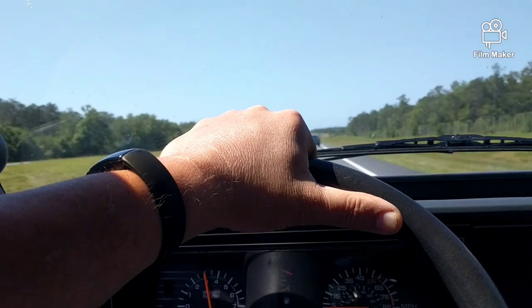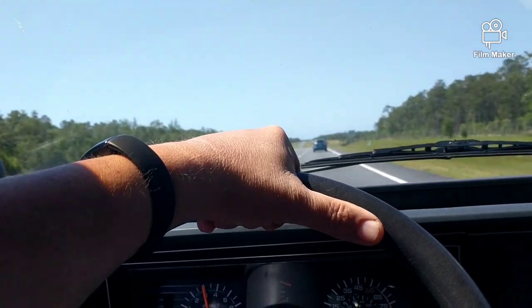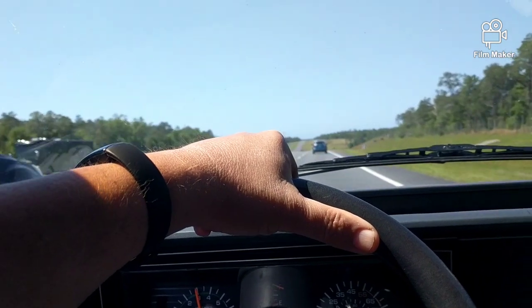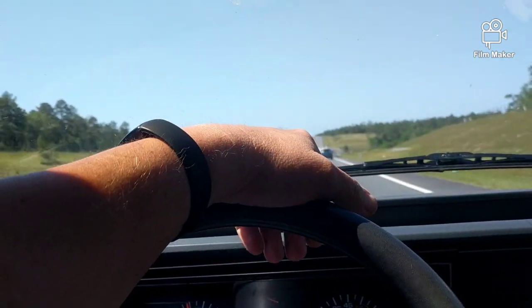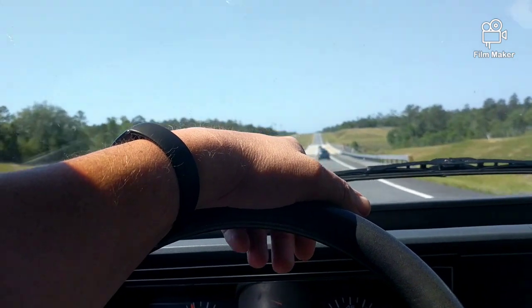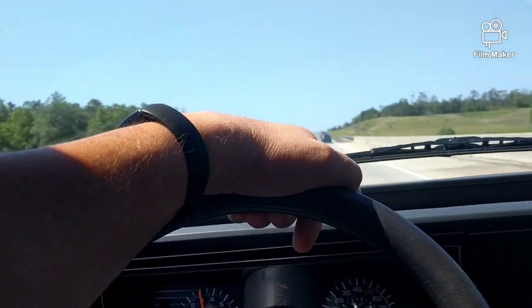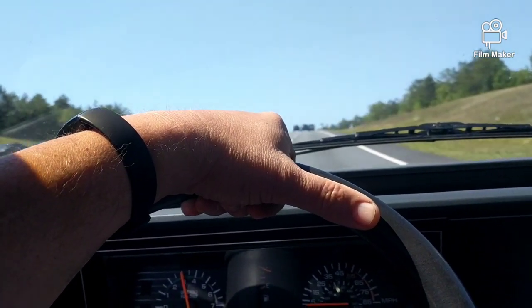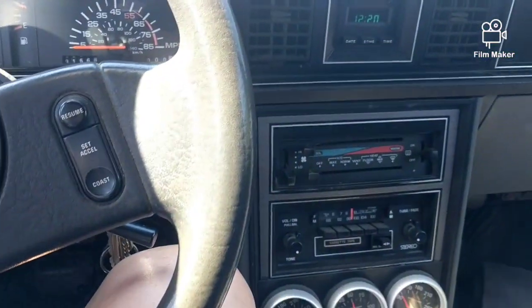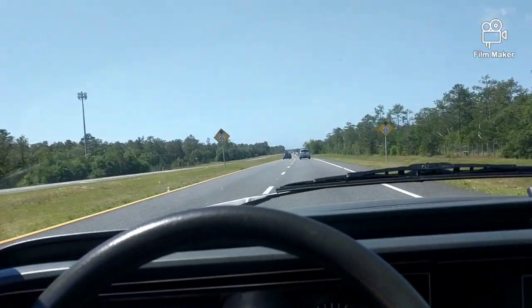The overheating issue is kind of remedied a little bit. I turned the DC controller down so the fan comes on quicker, and I put a 180-degree thermostat in it along with the high-volume water pump - it's a 180-degree high-flow thermostat. But it still tends to run like 210 when it sits and idles for a little bit, so I'm going to put a Mark 8 fan on it - I've got one at the house, I just need time to put it on. It runs fine on the street running 188.